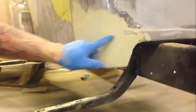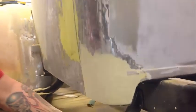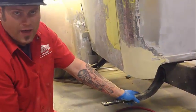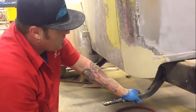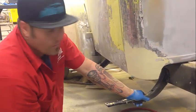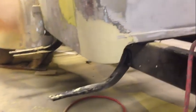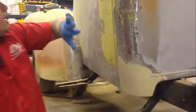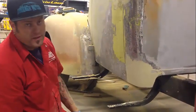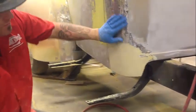You can see the metal starting to cut through in different little places, so I'm not going to have to smear any filler on there again. I'm going to switch to the poly filler — it's a thinner product, sands easier — and I'll start that with 80 to fill some of these rough scratches up. Don't feel bad if you don't get the filler spread right the first time, because it hardly ever happens. This small repair on the side of the cab — I might spend a day, two days, four days — whatever it takes to get it sanded flat.